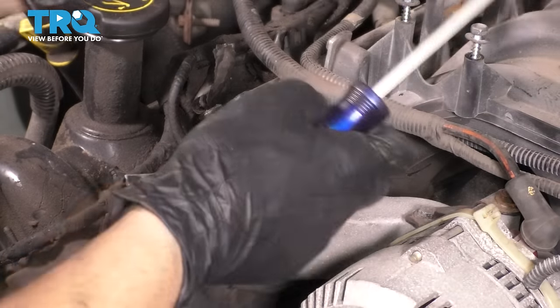Now let's put in this bracket, which has the EGR pressure sensor on it, and then this solenoid here. This went right in here behind all these vacuum hoses. This hook, this loop here, went over this first bolt on the EGR valve. So you'll have to slide that over. And then it has a nut that clamps it on.